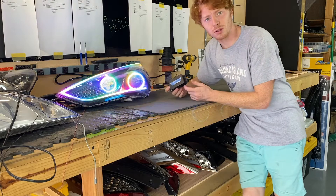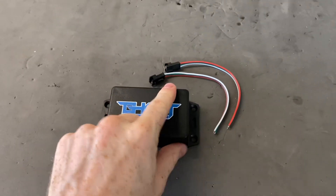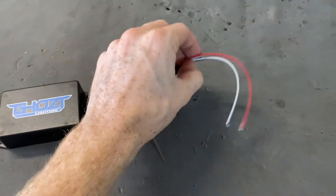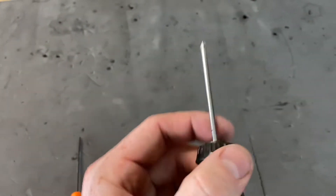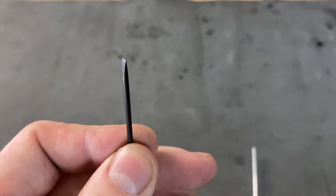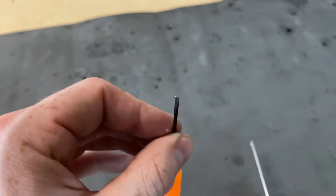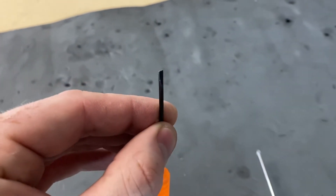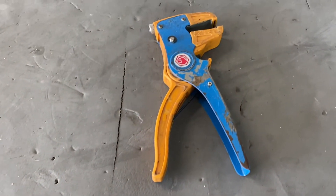It's going to give you the most customization of your headlights and taillights. So let's start with what all you'll need to wire it up. The first and most obvious is the BlueGhost module, which comes with the module and two connectors. Next up is a small Phillips head screwdriver and a very small flathead screwdriver — even smaller than some of your pocket screwdrivers. The screws inside the module are really tiny. You're also going to need a pair of dykes and a pair of wire strippers.